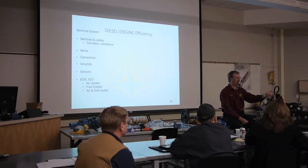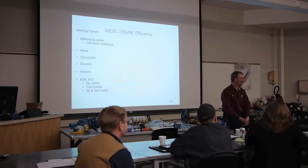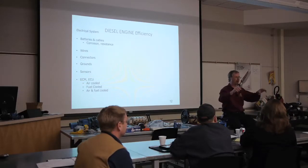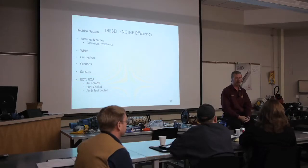I'm a big proponent of firing those engines up and getting that oil moving. Well, now I've got to haul those big batteries back out there, and some are easy to put in and others really suck when you have to lift them up high. So now we come to disconnecting. I would be a big proponent of leaving the batteries in if they're not really accessible, and just disconnecting both your positive and your negative terminals. Just get them off of there. Your battery is going to get cold, but with them connected, we can have parasitic drains. That's what drains your battery down, especially in cold weather.